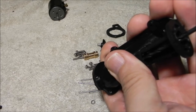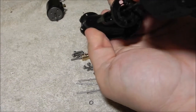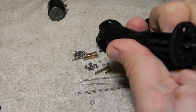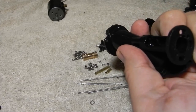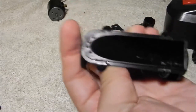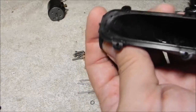The trick to this is to center the bit. I've been doing this a long time, so you want to look at it and make sure you have it basically centered in the hole. That's pretty much where I've got it centered. We'll flip this around, take the drill, and clean up any plastic down in here. You can see a nice little piece there — that means the bit was cutting very nicely, very sharp.